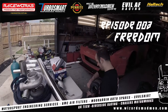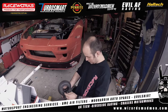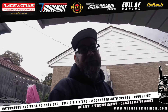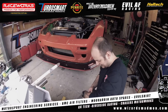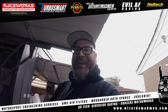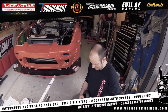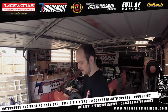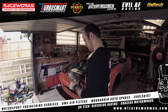Today we're going to see if we can set up the turbo kit for this car. We've gone for this setup because it's about the perfect size turbo for the engine size and the power we're trying to make. It'll make a decent amount of power on low boost with a stock motor, and then if we put a forged motor in, we can wind the boost up and make 400 plus kilowatt at the wheels, which is what we were aiming for.